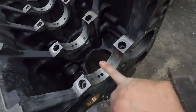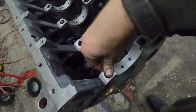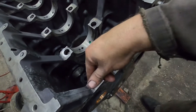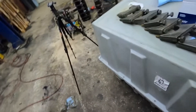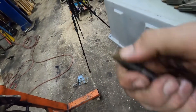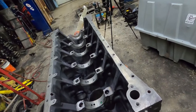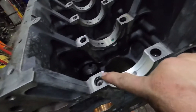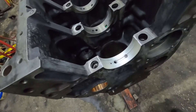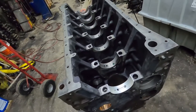When putting the bearings in, before I put you guys back on time lapse — you want to make sure this surface is clean and dry, you don't want oil on it. I set the tang side first and then just shove it in, making it equal on both sides. It will sit up high on one side but make it equal on both sides. When you're putting your bolts back in, you want to put a drop of oil on each one — literally just a drop. If you're doing studs, I use ARP lube or whatever brand you're using. Then you do the same thing on your cap side — tang side first. I just like doing tang side first so you can locate the bearing and then slide it in.